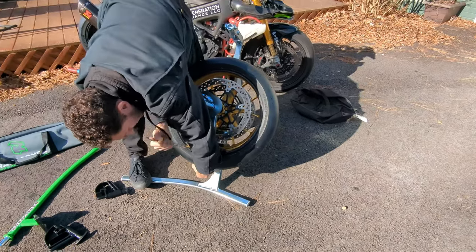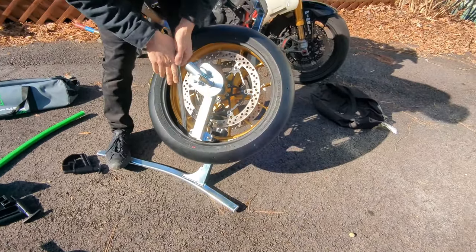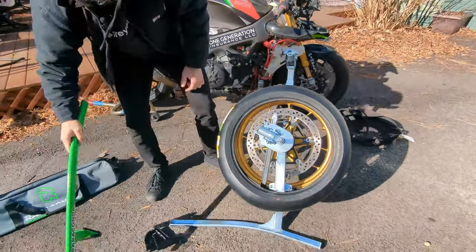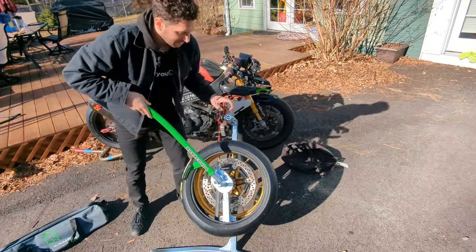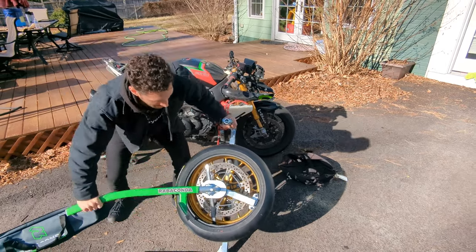Same thing on the back side. If you've got a really hot tire you can just take it off and peel it off by hand. For the sake of this video I'm going to grab the tire again with my tire iron, pull it up over the duck bill — it locks into place behind here — and again with my bar I'm just going to work it around the wheel.